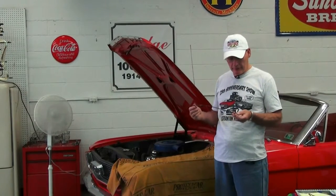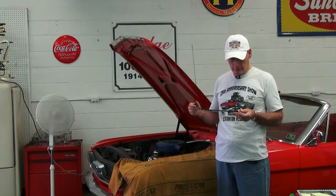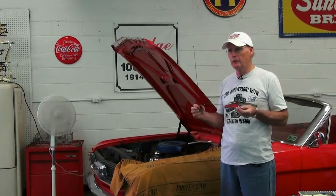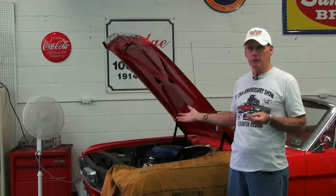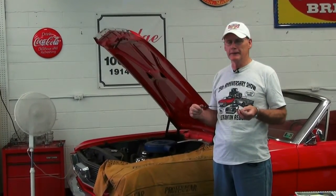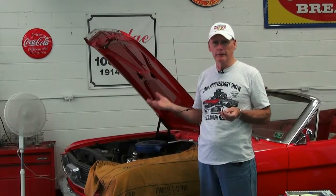Just by looking at the oil you can tell a lot about the condition of this engine. I would say this is okay — no strong gasoline smell, just a little bit — but any carbureted engine going way back, even into the teens and twenties on up until we get into fuel-injected cars, anything with a choke or carburetor will end up with a little bit of gas in the oil. Normally this isn't a major concern unless it gets really diluted, because then you're taking away the lubrication quality of the oil and you're going to start wearing internal engine parts.